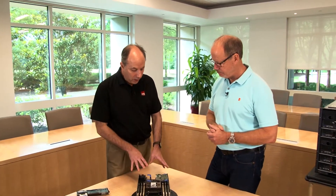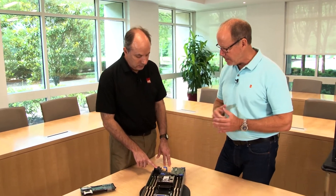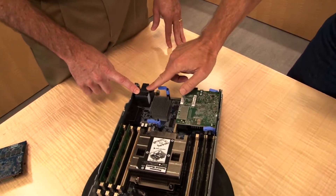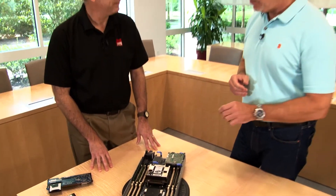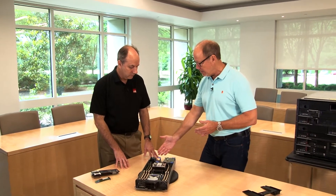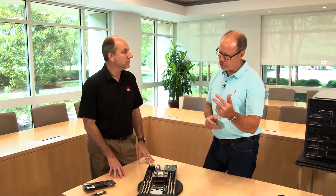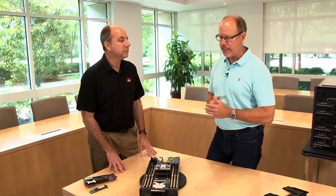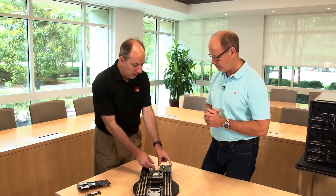For I/O, this server has the fabric connector — also known as a periscope connector because it looks a bit like a periscope. It lifts up four times 10 gigabits of Ethernet. There's an Intel Ethernet controller built into the chipset that we've decided to take advantage of, offering a high-performance, cost-effective network connection. This routes through the midplane to the I/O modules at the back of the chassis — it's a four-port connection, with two ports going into one switch and two into the other, giving you a redundant path should you lose one. No transceivers needed.